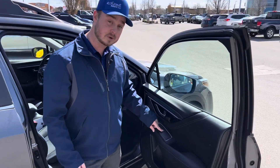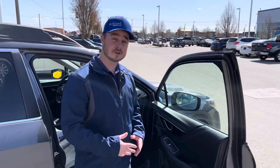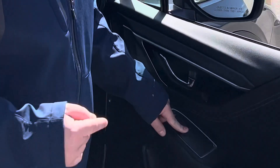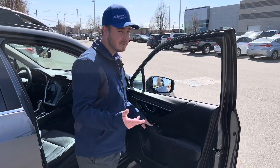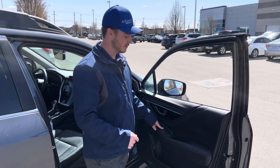You're gonna want to hit this switch on the passenger side with the car on, so make sure you're in a ventilated area. Press and hold that down, and continue to hold it down for seven seconds even after it's gone down. There's a faint click — you may or may not be able to hear it, but within seven seconds you should be good.